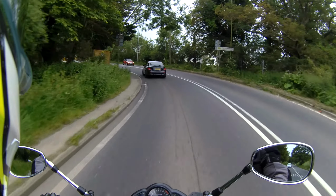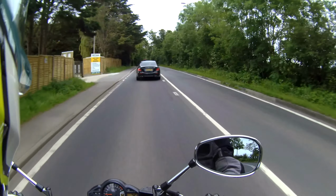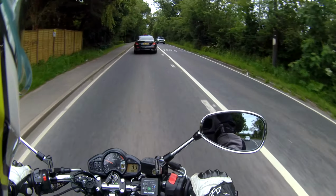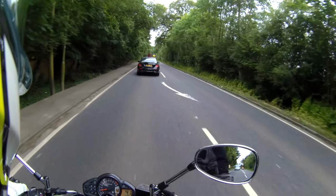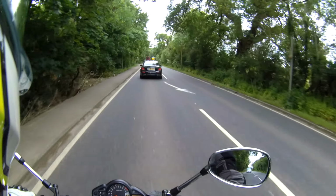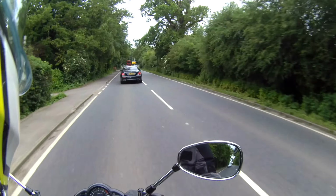And, you know, I topped it up to the appropriate amount. I will probably have to top it up again. I will check after riding around, because that's why I'm riding around, just to have a look how much coolant I need to add. And then I flushed my reservoir, which is underneath the tank, in the guts over there. So it's not very easy to take it off. It would be the best idea to take it off.